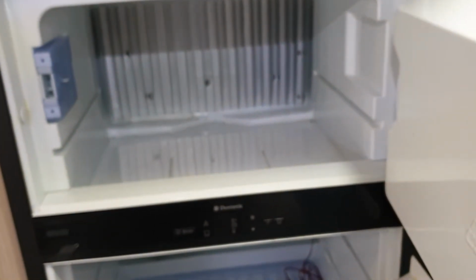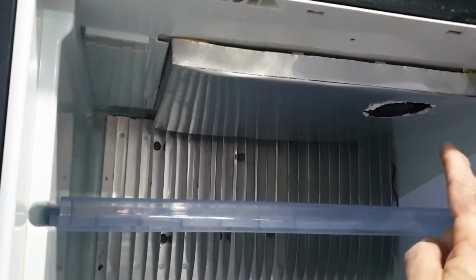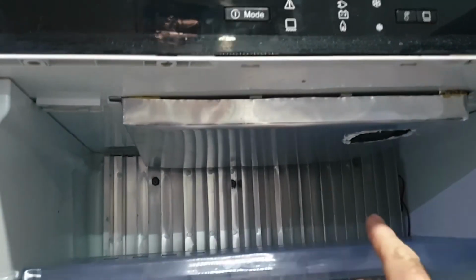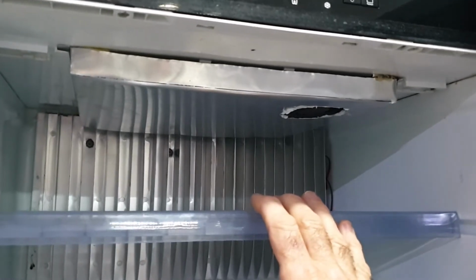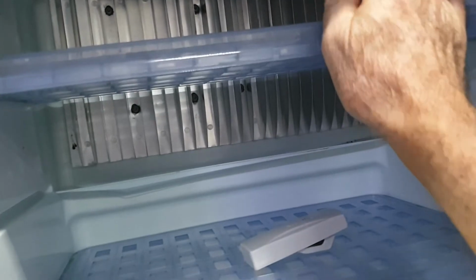And fridge done. Last thing I did to this was I've put a fan in here. Now in this fridge there's a couple of little plastic slots that are created on either side here. This is about 330 millimeters wide, so it's actually brilliant. So I made up this, just sort of fabricated out of that 1/2 mil aluminium, and on this side over here I've put a 60 millimeter 12 volt fan. It's a little small thing, it's not very big. Bring this forward.